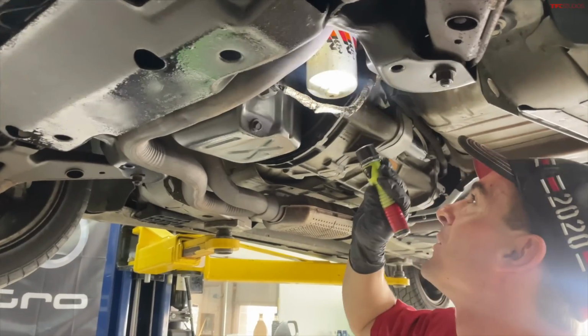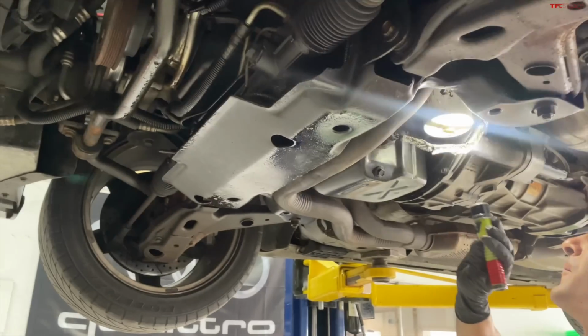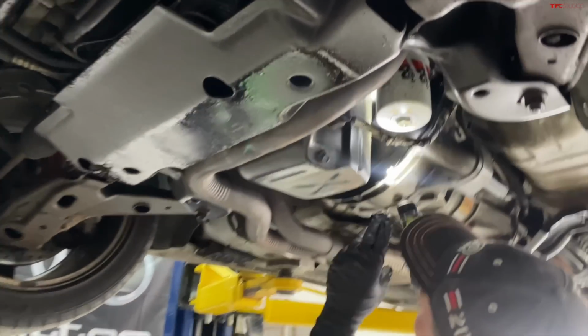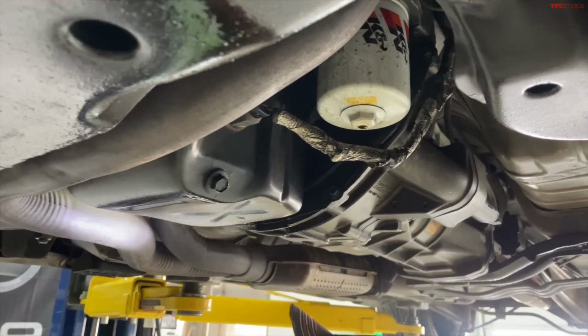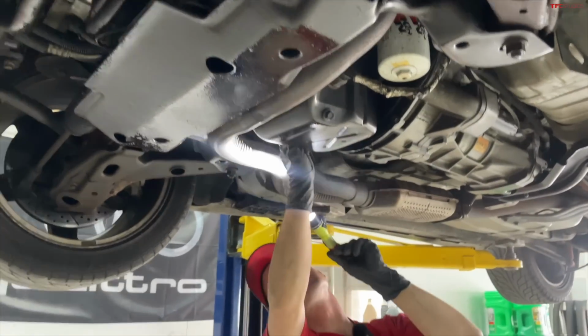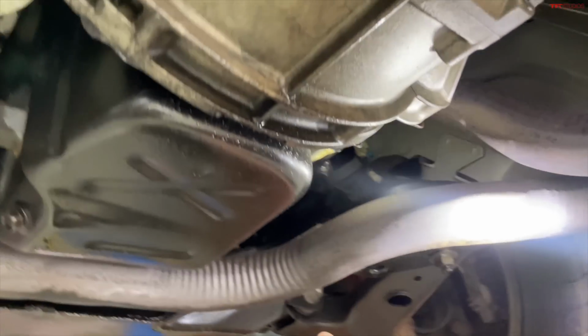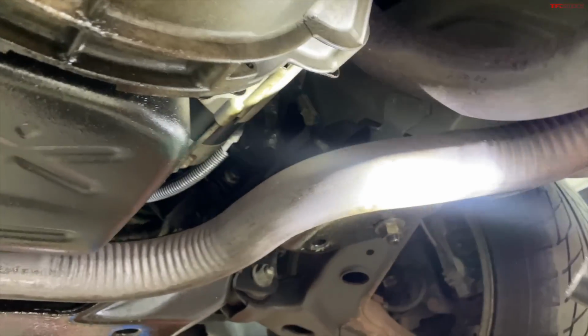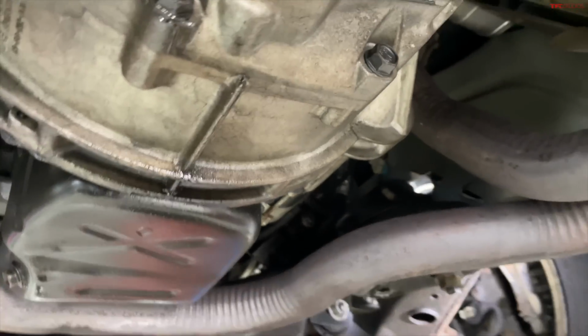Yeah, you got multiple issues on the oil leak side of things, in my opinion. You definitely got the biggest ones up front. You definitely have a few small ones in back here, too. Could be coming out of the back main seal there. Okay. And there's that starter you guys were asking about, how hard it is to change. It's not the end of the world. Oh, it's just sitting right there. Yeah, as long as you get it unbolted nicely and can snake it around the exhaust and not burn your hands, you'll be fine. Yeah. That seems pretty easy to get to.